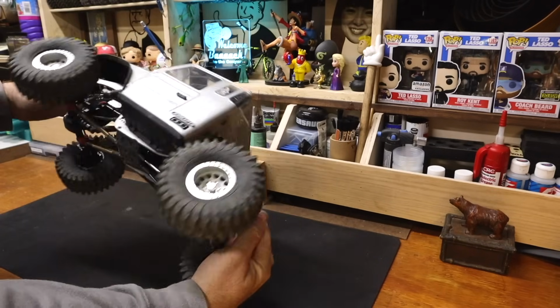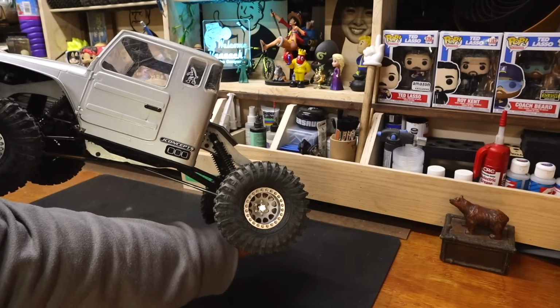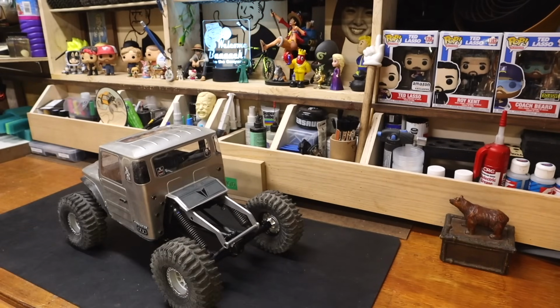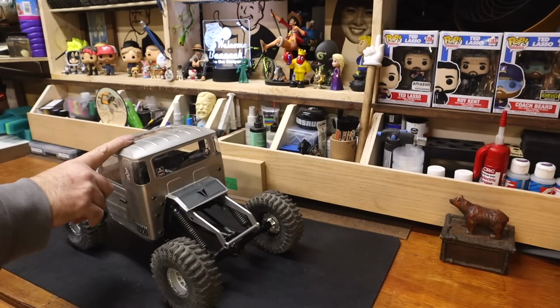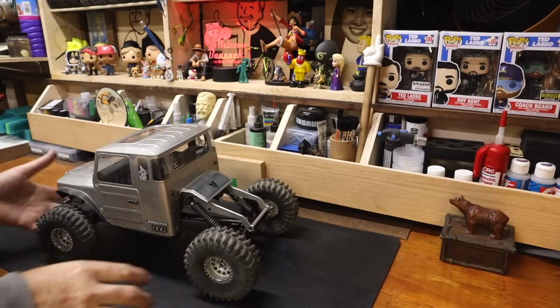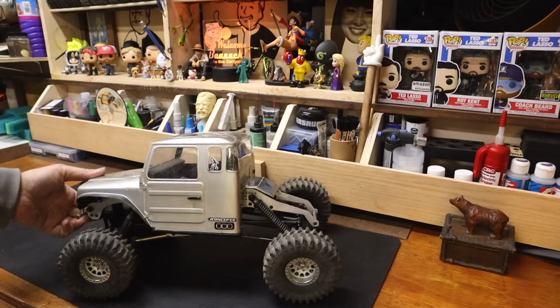So there's a Stealth X. We kicked the living hell out of the skid. He's like 12 degrees down there. I put an underdrive in the rear. So he's got 12% inside the gearbox, 9% here. So he's 21% overdrive. We're going to see how that does. I made no changes to link positionings, link lengths, anything.